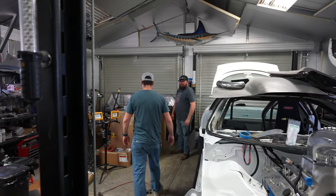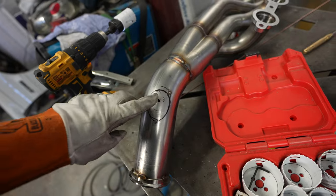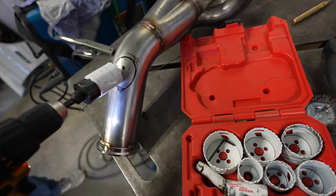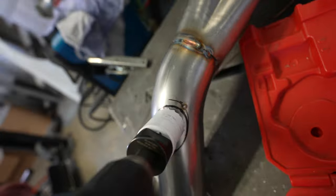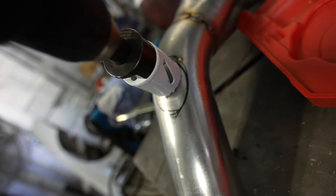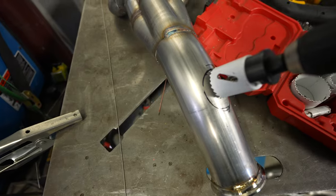What I ended up doing is putting a center hole here - got my hole saw - that's going to get me real close to this back edge. It'll come real close to the back edge and then I'll just have to take my die grinder and clean up the rest, or use another little hole saw back there. Otherwise that should get us close to clear. Now the wastegate spot.